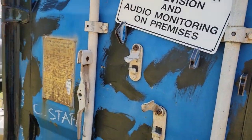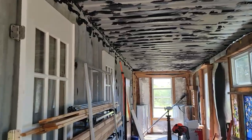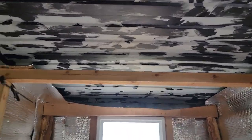So the video today wasn't just the outside, but it was all of the inside. So all I did was any place I found a bit of rust, I went ahead and chased it. Once I get the insulation in — like on this side, this bubble wrap — that is going to prevent the differential between the metal and the inside, so I won't get the moisture buildup on the wall, which will further reduce the amount of rust I get. It was like $150 a gallon. One gallon has done all of this, and I still have a little bit left. I'm thinking one gallon might get me the underside of both of these, although there's a lot more rust underneath.